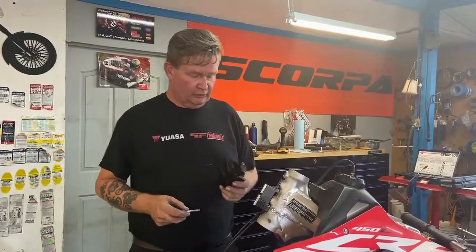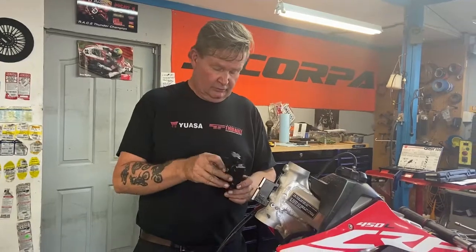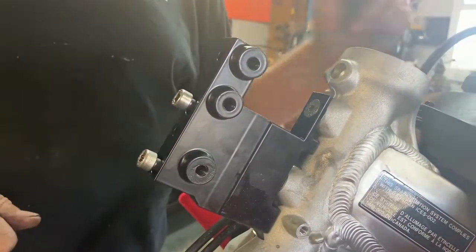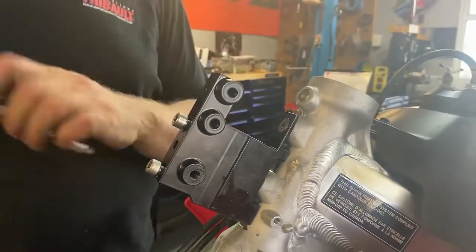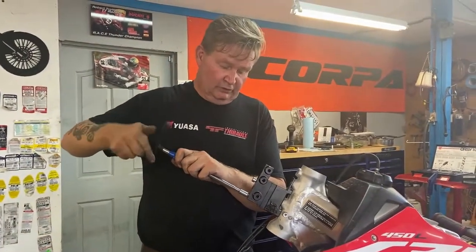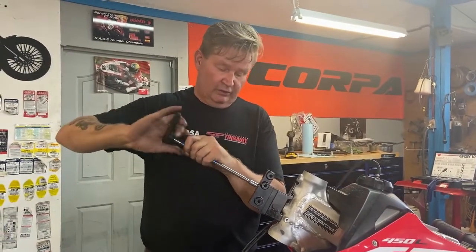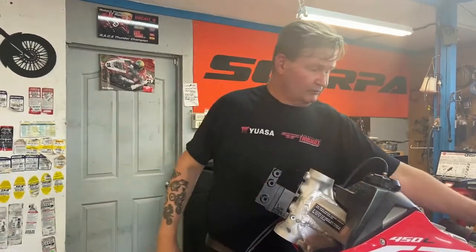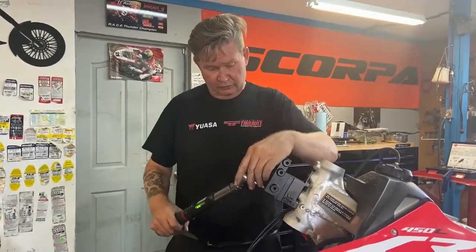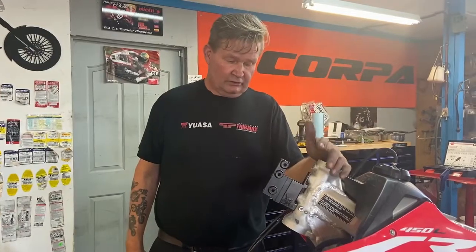This is the second portion of the tower mount — it's got two grade 8.8 bolts that fit through it. It's pretty snug fitting because it is powder coated. First thing you want to do is just snug them down. If you look up torque charts for an M8 x 1.25, usual torque is 30 newton meters — but that's going into steel. This is going into aluminum, so I'm actually just going to run 20 newton meters. This is more or less a test fit right now, so that's where we're going to set it.